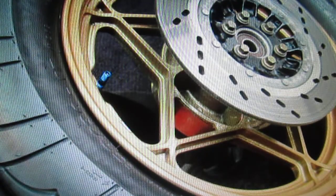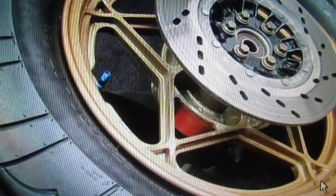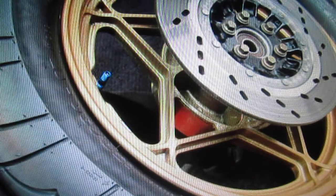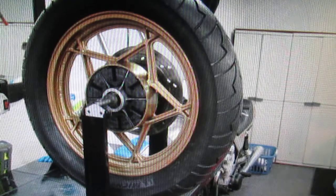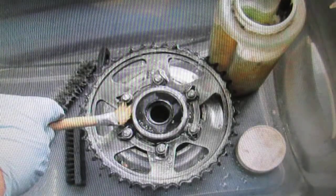If that tire is cold, even with the duct tape it's difficult to get on. When the tire is hot it seems like the best of all worlds. The ideal would be to heat the tire and leave the rim out in a freezing cold garage - put the tire in a tire heating box. I'll put in the air and the bead seats totally normally. The balancing routine is unchanged - nothing changes there. Then I really wanted to move on to the next thing.